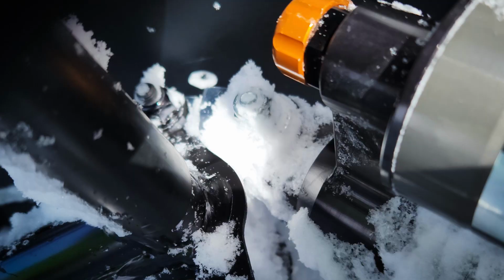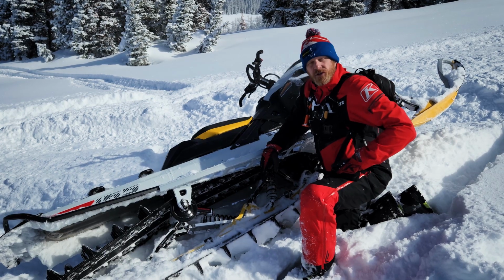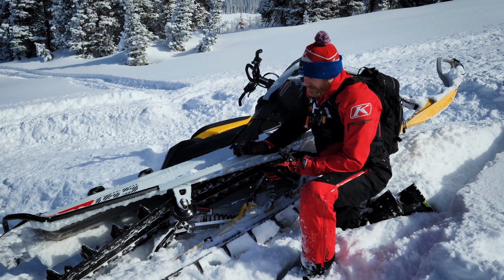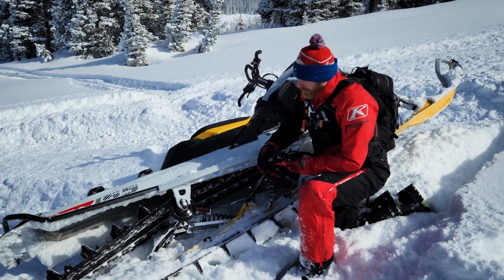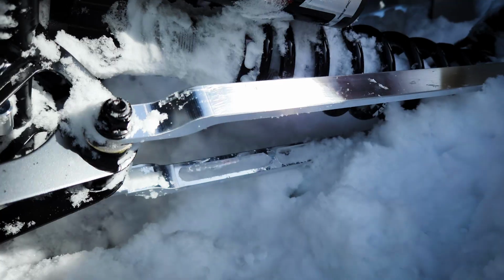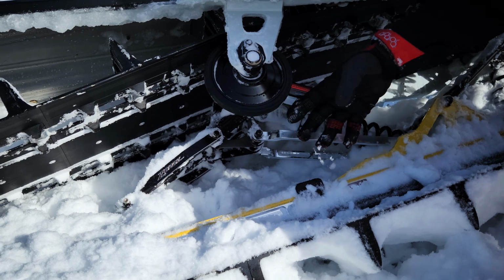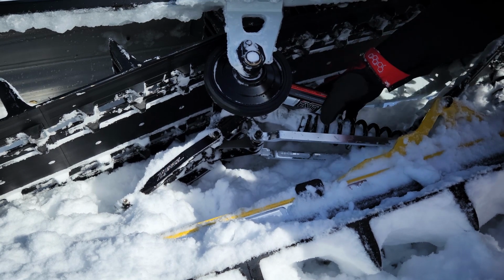We have an X1, which is a piggyback compression adjustable shock, and then the X2, which is compression and rebound, and the kit's gonna come ready to be bolted on. There's no special parts needed other than what comes in the kit that we provide. Converting the factory Gen 5 from torsion springs, which you don't see in here anymore, to a coilover shock.